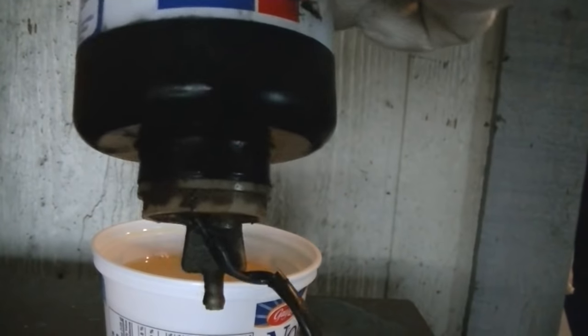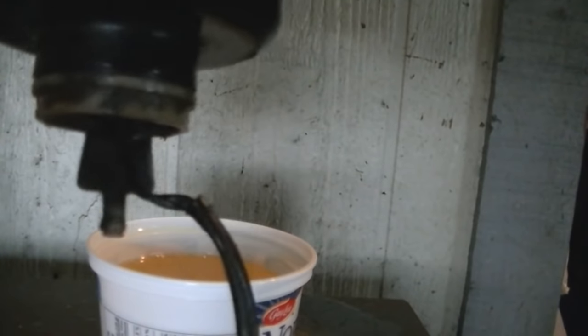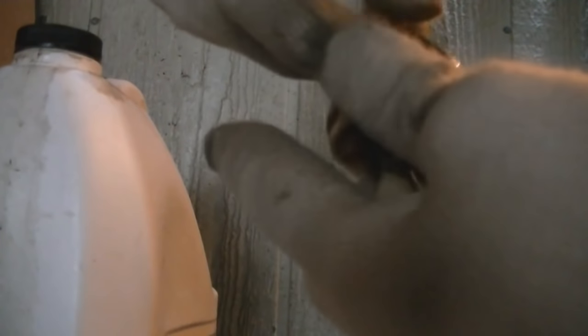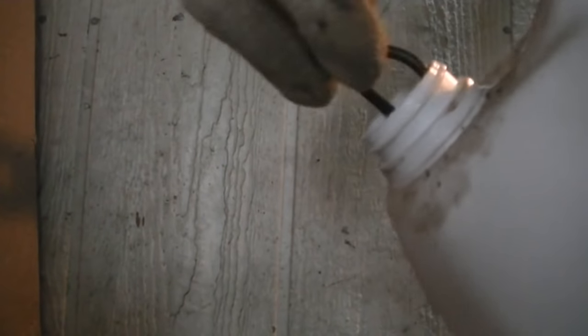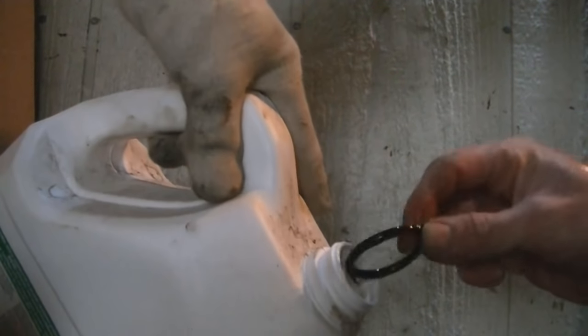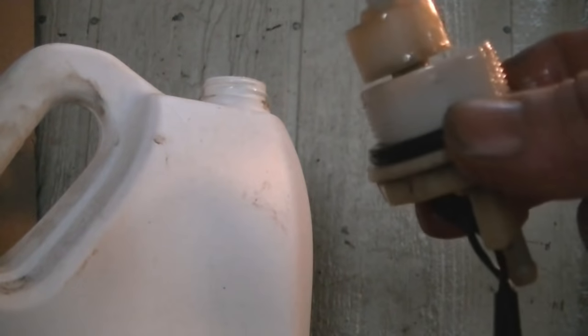On the bottom of this here is that drain plug with the sensor — carefully unscrew that. Take off the old O-ring and just clean that up a bit. I know some guys use diesel oil for this, but I like to just dunk them in a little bit of engine oil, just a little bit of a coating on there, and push it down in place.